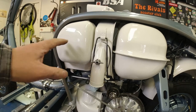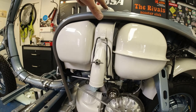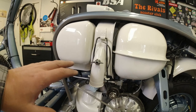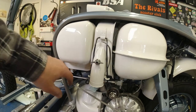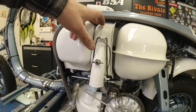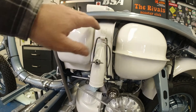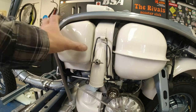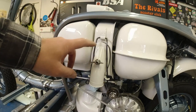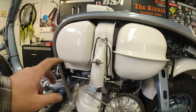Voilà — that's the air box fitted, and as you can see I also fit the air intake scoop with my hex keys. All went in pretty good. I did actually have to loosen the bolts on the air box a little bit at the bottom to bring the airbox forward, as it was catching not just on the screw but on an indentation for the screw, so I only had to take off a couple of threads but I had to turn the toolbox slightly round to get them in properly. Inside I've fit the PGM high-flow air filter, and the next job is to fit the carb.